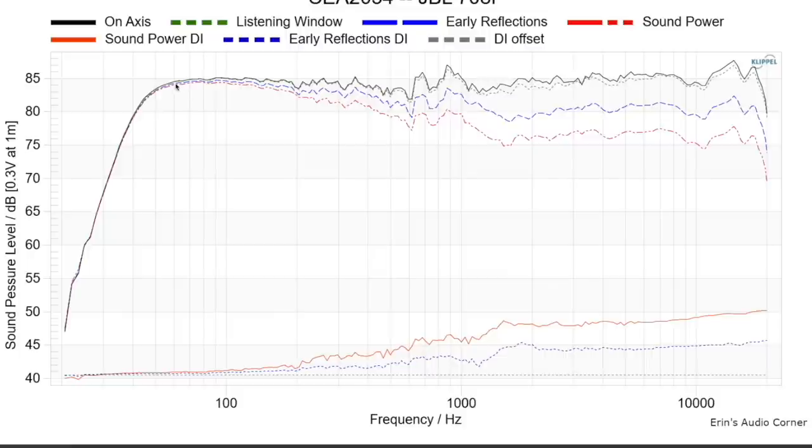The only issue I really heard was that the top end felt just a little bit too much overall — I'd knock it down maybe half a dB if I could, which you absolutely can via the speaker's EQ adjustments. You can notch down those peaks, bring up the midrange — but we're really talking about nitpicking a speaker that is otherwise quite good. It doesn't start rolling off until about 50 Hz, and its F3 point is somewhere in the 40 Hz region. It's a really good speaker overall, one that I enjoyed listening to a lot.